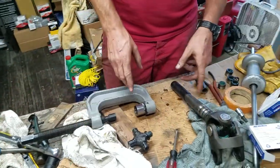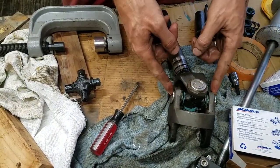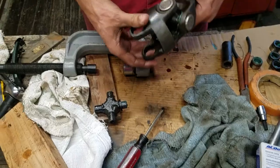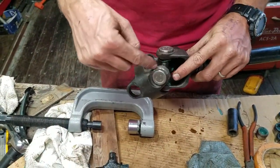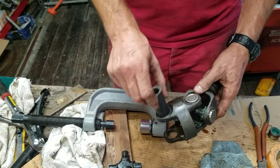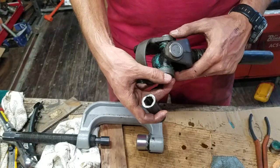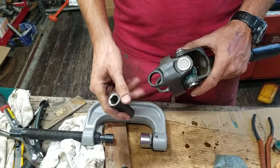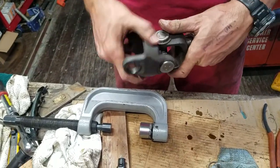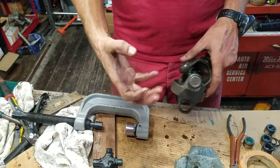To take these out, the first thing you're going to do is remove the snap clips. Some of them sit on the inside, some of them sit on the outside. Once those are out, you pretty much put that socket around one of these and then get another socket that fits through the yokes and you literally pound it out. When the cap is able to come out, you flip it around and repeat. Sometimes when these caps come out they're very tight — you can pinch it in a bench vise and rotate to pull the cap out, or use a pair of vise grips.